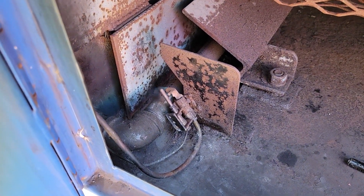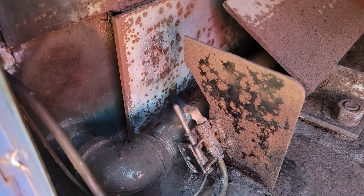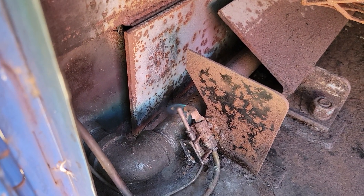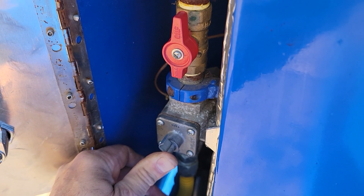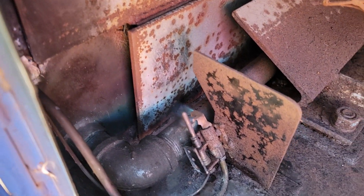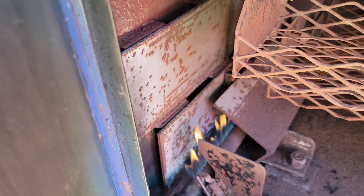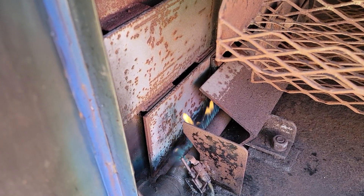Sorry to put the phone down, but that's the way it is. Can you see the pilot light? We lit that. Hold the pilot light burner down for about 20 to 30 seconds — that's going to heat up the thermocoupler. I'm going to release the pilot light button now. Hopefully the pilot light stays on — it's very windy. Yes, it's staying on. The thermocoupler is hot, sending a signal to open the valve. We're going to turn this to the left and there it goes — you can see the flame. It's really windy here, so use one of these lighters; don't use a little match or you'll burn yourself. We're going to close the door just so you can see more — there's your flame.